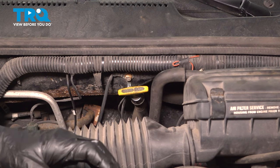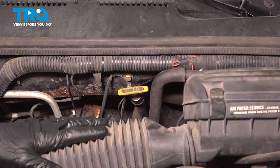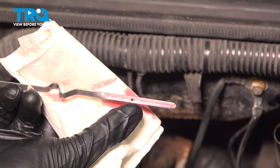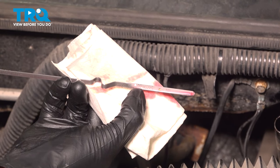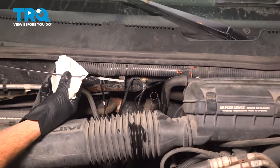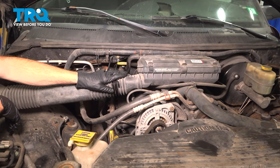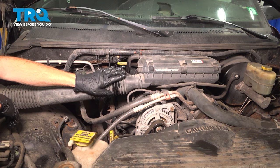Once I've made my way down to the bottom, I'll make my way back up all the way to the top, pausing in each one of the gears. We'll do this several times while the vehicle gets up to normal operating temperature. Looking at this dipstick, we have our small dot here, and up above it we have the hatched area. My fluid level is right up to the top of that hatched area, which is exactly where it should be. We'll give that a quick wipe and reinsert it. At this point, I'll turn off the truck. Go ahead and close the hood, double check to make sure you don't have any leaks, and then take your vehicle for a road test and make sure the transmission shifts perfectly.